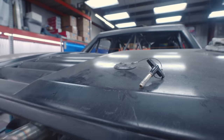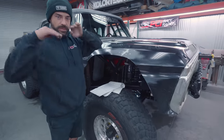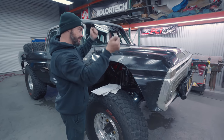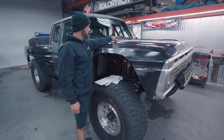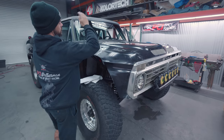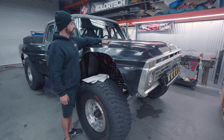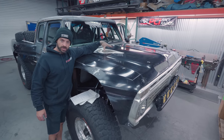The traditional way is a hood pin with a rubber auto-fab style grommet, and when you tighten them too much they get wavy — it's just not a good detail piece. Those were probably originally built for a four-pin style hood where you pull it off with a buddy. When you put them on, you kind of palm-slap them to seat down. Instead of that, we ran the traditional pin but got a win with the venting — we opened up the hole and the landing pad for the pin and hold-down is actually venting too, right above the shocks. So it's not getting water into the engine bay.